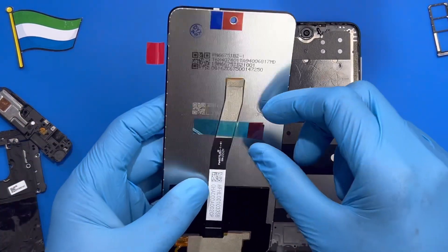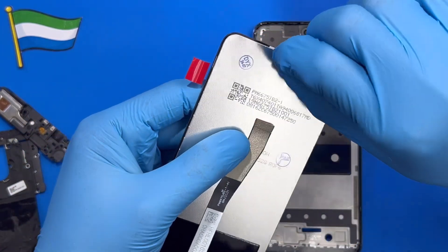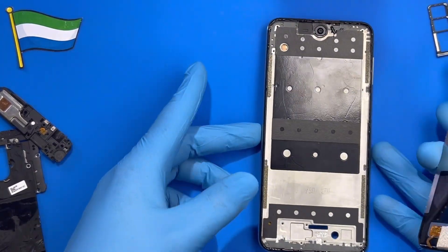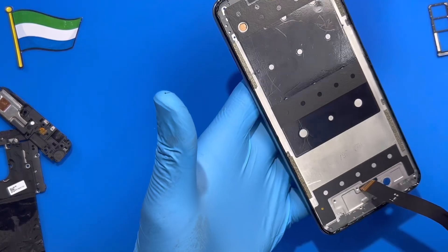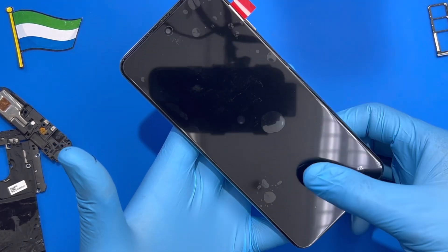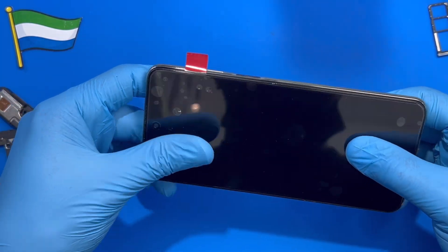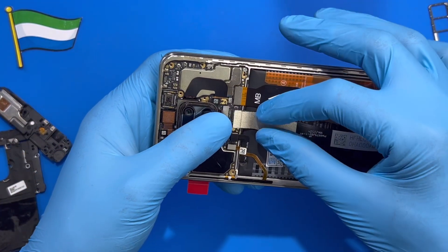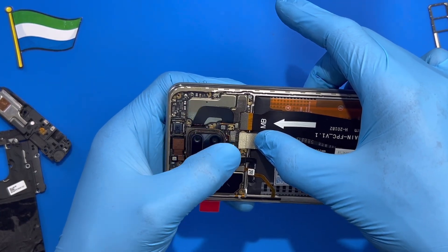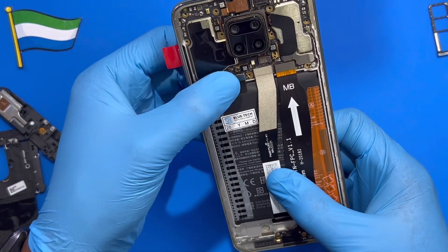After you put the glue on the phone, remove the sticker on top of the front camera so your phone display becomes very clear. Now pass the connector down here like this, very nice. Put the LCD in very straight — don't bend it. Press it inside. Fix back the connector very straight — make sure you get the right position before you press it in. Don't force it in the wrong position so you don't spoil the connector on the board.